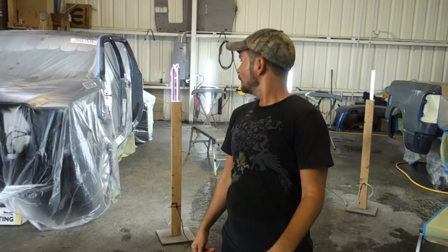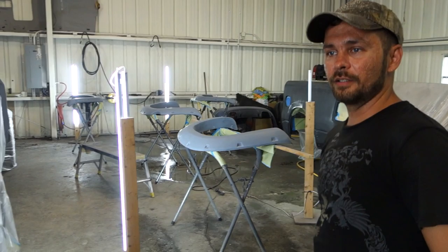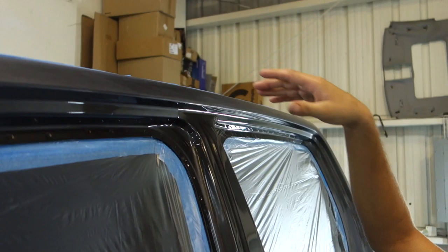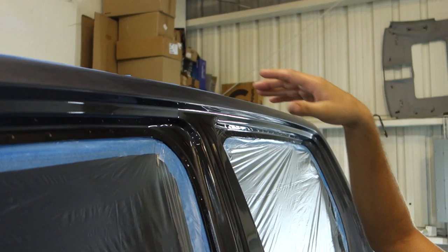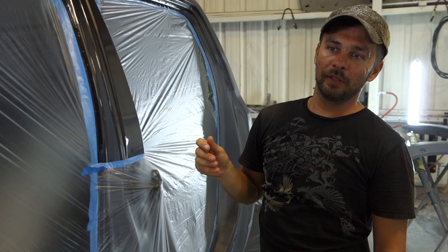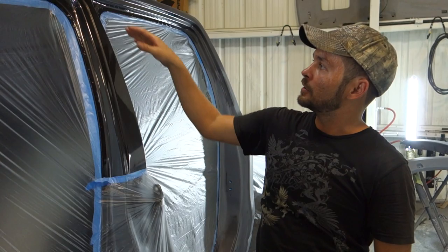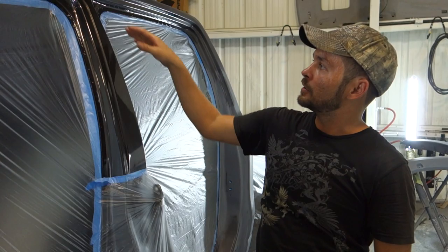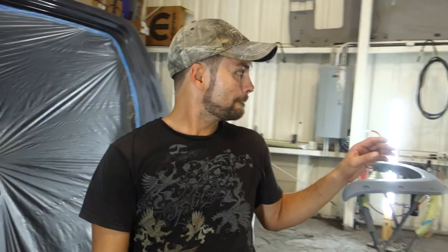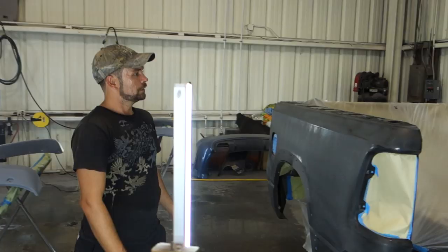Alright guys, so we're ready to paint finally. We've got everything all taped up, we've got the door openings taped up. You might think, why is this shiny here? Because I'm actually spraying clear coat — the paint is going to get blended here and blended here. This is just going to be clear coat, and I'm going to use the blend spray to blend everything. I don't want the tape lines anywhere close because that blend spray will actually melt even the original factory clear coat. So we're going to do the blend spray wherever it lands and that way we don't have any tape lines. We've got all the flares taped up as well — they took a really long time to prep but it's going to be well worth it.